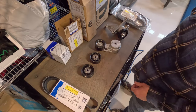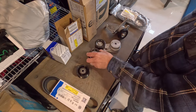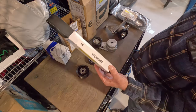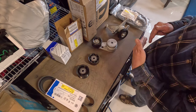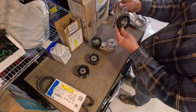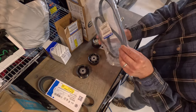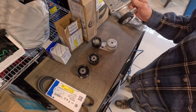The parts we are replacing are: the hydraulic tensioner pulley, the idler pulley, and the mechanical belt tensioner pulley — all for the main drive belt. Behind the main drive belt is the accessory belt. The accessory belt tensioner is on the lower driver's side of the block.